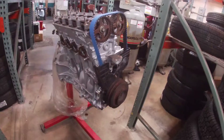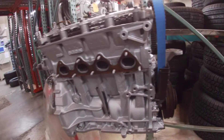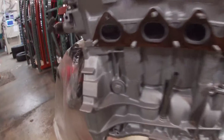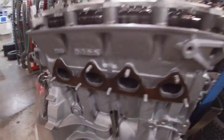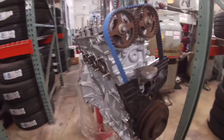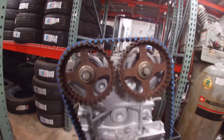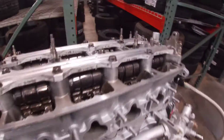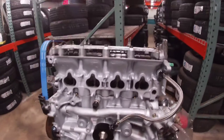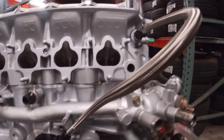Let's go and take a look at this motor. Here's the motor guys — she is pretty fresh. It's a B20B that's the bottom end, GSR head up top, got the timing belt on already, stock cams, stock cam gears, but other than that the motor is pretty much fully built. That's for the LS/B-VTEC conversion — B20 VTEC, same thing.